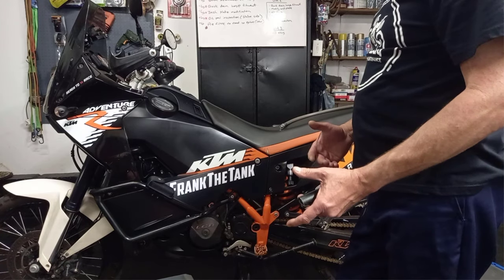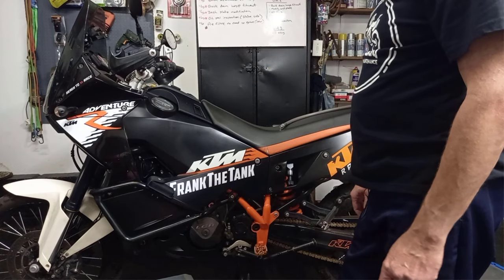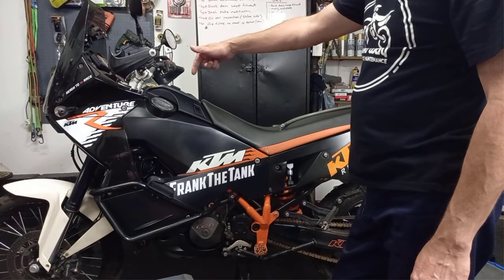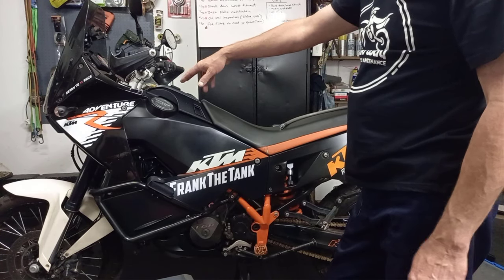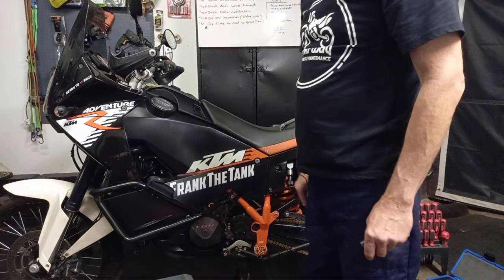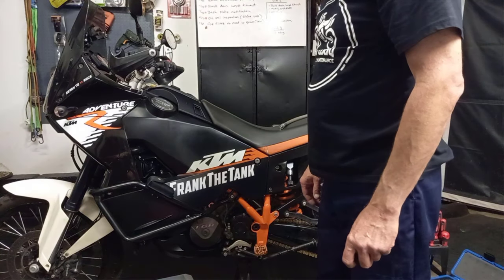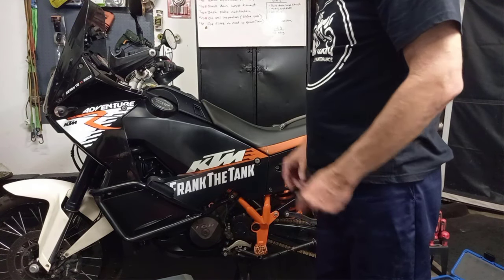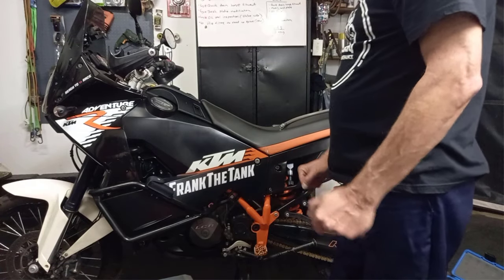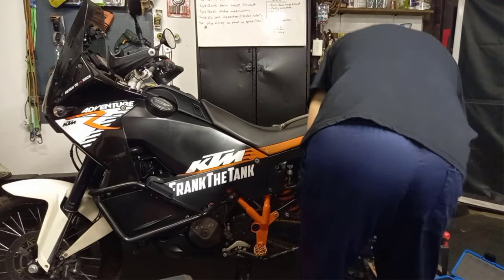If there are details that I need to show you, the cameraman will come in and zoom in on the bolt. Another important note, when changing plugs on your front, you'll have to loosen up your radiator so that your radiator can tilt a bit forward to gain access into that area. But I'll show you the plugs and tools that we need on that. Specific plug spanner, 14 mil with a swivel head. But I think let's carry on. Let's keep cracking.